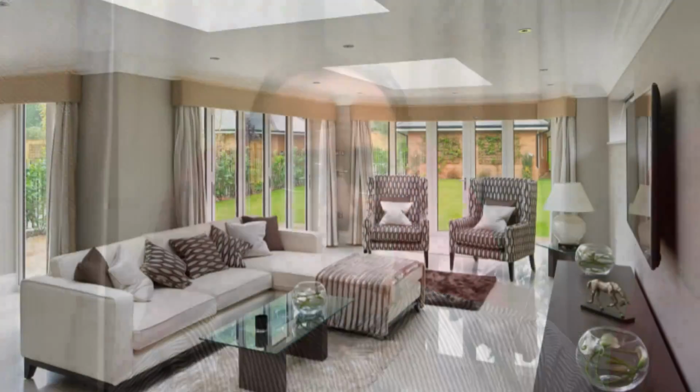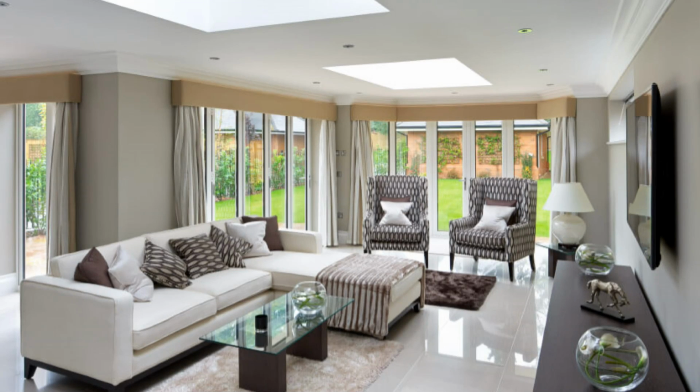That's controlling lighting and noise, external noise to be precise. So whether you're using a fixed panel display or front projection, you really want to be able to control the natural lighting in the room. If you've got a sliding door that brings in a lot of sunlight, that drapery will not only help acoustically, but it'll help block out that light when you want to be critical about what you're watching on your TV. If you've got a lot of reflections in the room, if you've got surfaces that are shiny, try to find ways to cover that.